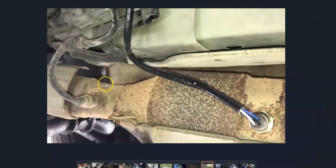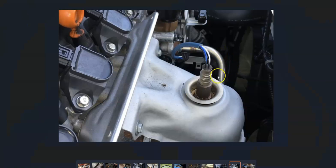This sensor can be located either down underneath the car on the exhaust, or in many cases it'll be on the exhaust manifold right inside the engine compartment. It varies by Honda model, so you may need to look it up, but it's fairly common for them to be located right on the exhaust — either straight on or sideways. Either way, it'll be the one right before the catalytic converter.